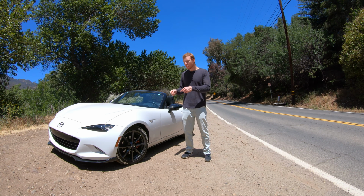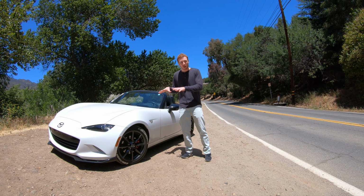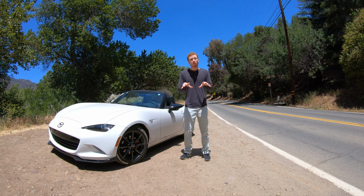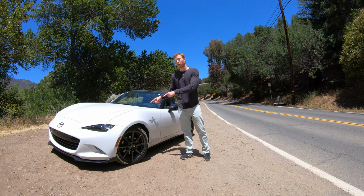The Progress springs really help tame the floatiness I felt in the car, and it seems much more responsive on inputs. But the body roll was still prevalent, so I'm hoping these sway bars are gonna tame that.